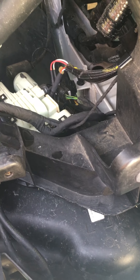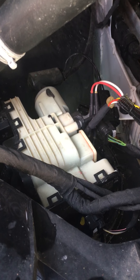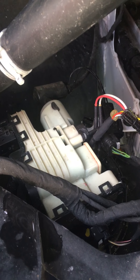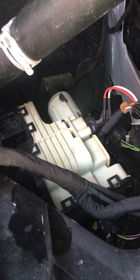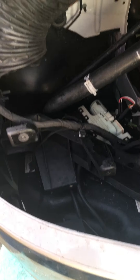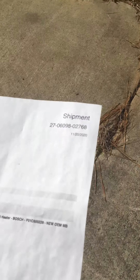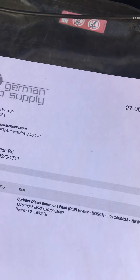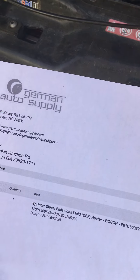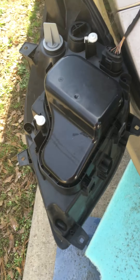The DEF heater was priced at $1,500 at Mercedes — I got it for $200 on eBay. Make sure you order the correct DEF heater and pump, because this is what they call the MH code, which is a motorhome chassis. If you order a regular Sprinter 3500 part it's gonna be too short — the sensor and heater assembly won't fit in the tank right. The correct part number is Bosch F01C600228, and it should fit 2011 to 2016 motorhome Mercedes 3500.